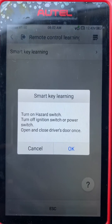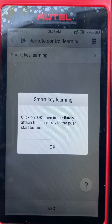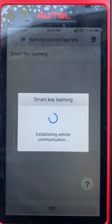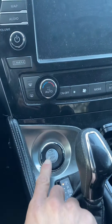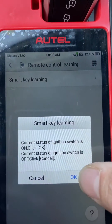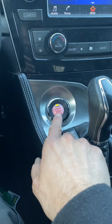Okay, hazards on, ignition off. Press okay, then immediately attach the small key to the push button — we're just going to press okay. Keep pressing the start/stop until the instrument cluster lights up, so we're going to press and hold until the cluster comes on. It's on — we're going to release. Okay, and ignition off, turn it off.